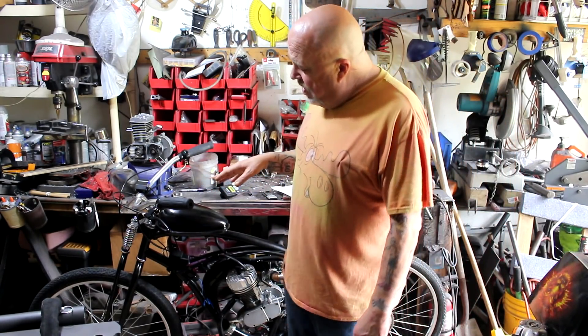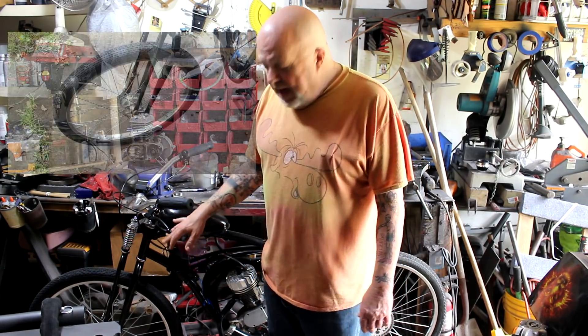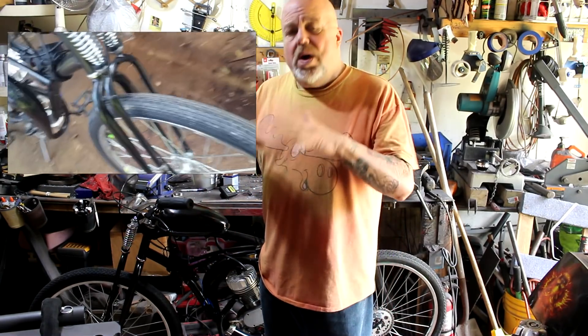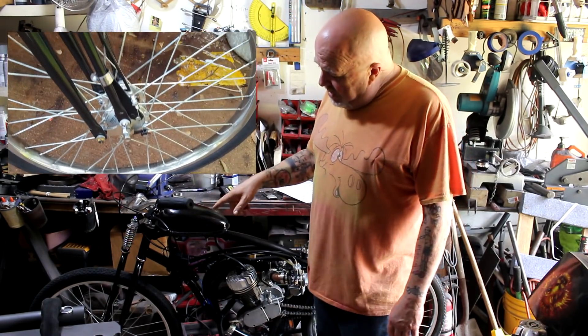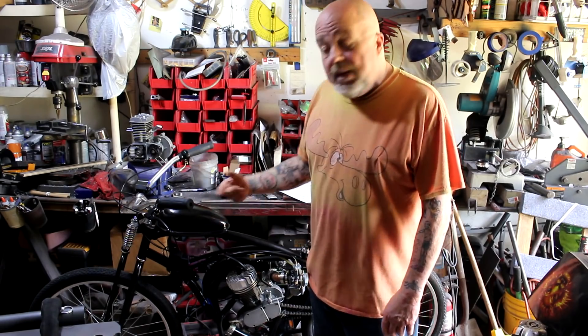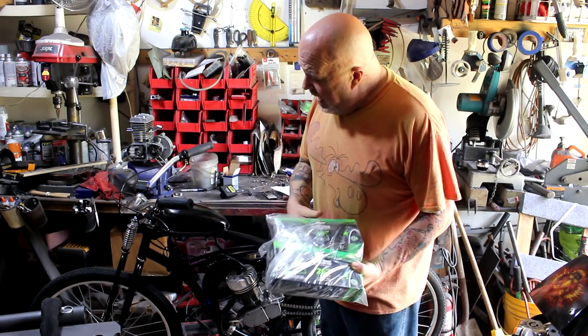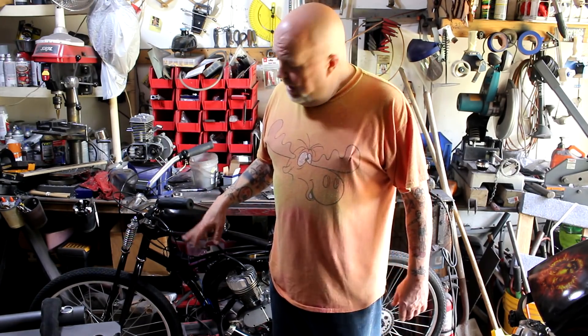I'll go over the components we've got. The front wheel has a moped-style hub brake on it. Check the link down below — I'll show you where you can buy all the goodies I used to build the bike. We've got 11-gauge heavy-duty spokes, a heavy-duty steel rim, the moped-style hub, slime extra-thick inner tubes, and the slime tire liner inside the tire. The tire itself is a Duro brick style — some people like the Maxxis hookworms, but I like the Duro.